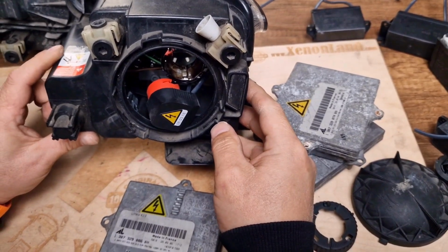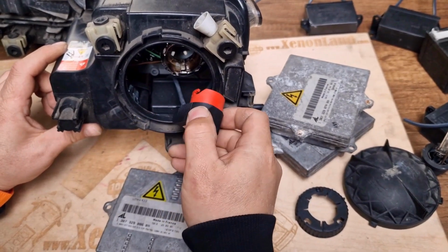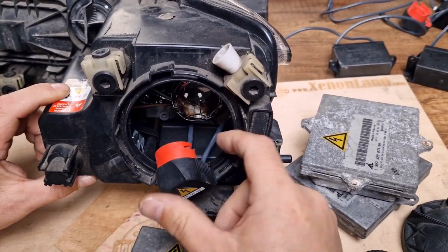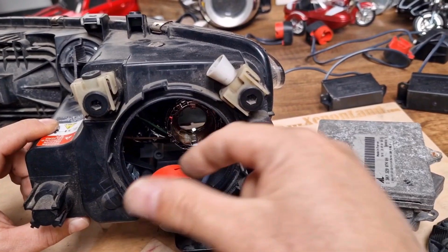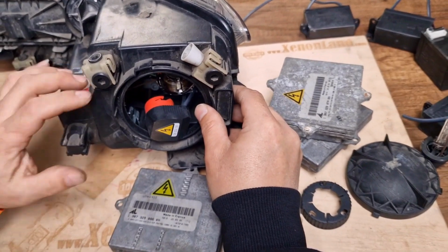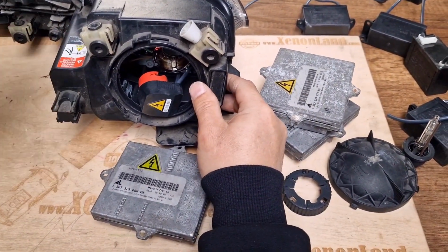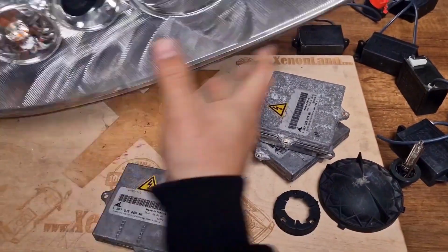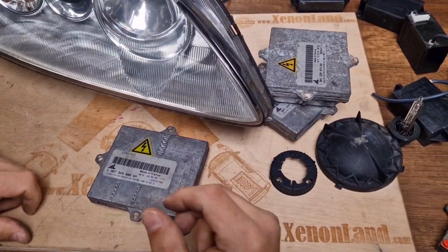The next video will be about how to replace this igniter, which is located, as you can see, inside the headlight. Basically, you don't have access to the fixing screws in order to unscrew them. So you have to open the headlight altogether. You have to remove the lens and replace it. In the next video, I will show you how to remove the lens and subsequently how to replace the xenon igniter.